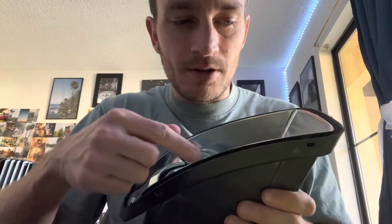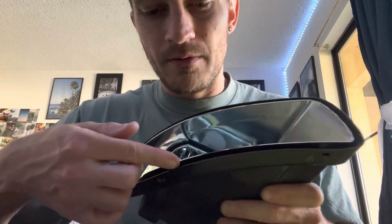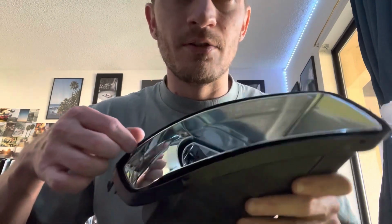When that happens, try to catch as much of it as you can along the edge so that it doesn't fall into the chrome. A little trick that I learned the first time around is you can use a screwdriver to collect some of that and also push a lot of that rubber back in the channel, so that it's easier to apply a bead of butyl rubber later when you go to reseal it.